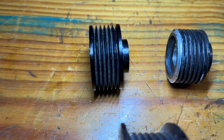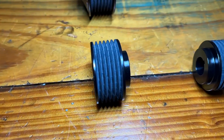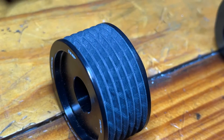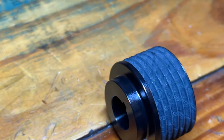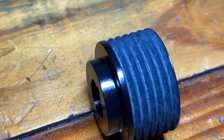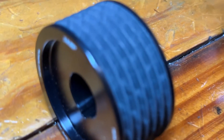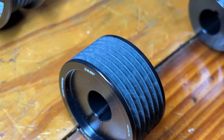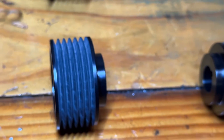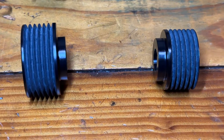This is a used kit — you can see why these had belt issues being so tiny. Now look at the texture on the GripTech pulleys right here. If you've never experienced this before, the closest thing I can say it feels like is 80-grit sandpaper. It's got a unique texture on there. We're electing for the more aggressive texture on these smaller pulleys because these need the most tension.